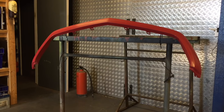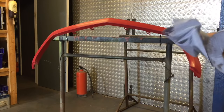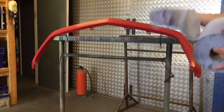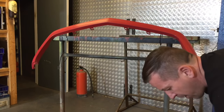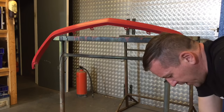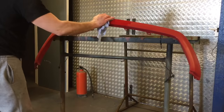As you'll have seen on the time-lapse, I was just prepping this grill. It is temporary — the van is getting wrapped and when John comes to sell it in a few years he'll have all the paintwork done anyway, as there are a couple of marks on the wings and the bonnet. So I've just scotched it off, gone over it with a bit of panel wipe, and we got that can of 2K from Kemp's Paints the other day.